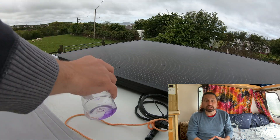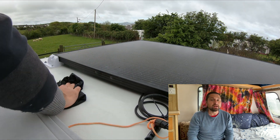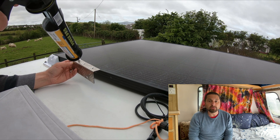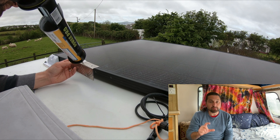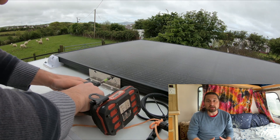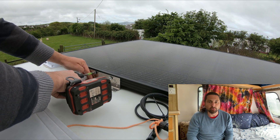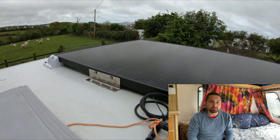A few days passed which allowed the adhesive to fully cure. Despite it being late May, day and night time temperatures had not been that high so I wanted to allow plenty of time for curing to take place. This also allowed me time to come up with a plan for new side brackets. In the end we decided to make use of aluminium angle from B&Q with dimensions of 50mm height by 30mm width, which was nearly perfect for the new side brackets. I was able to pick up the same holes that I drilled in the solar panel previously by locating them on a cardboard template, meaning that I did not have to drill anymore. The process for installing these was far easier than the corner feet had been as the panel was already locked in place.